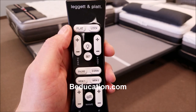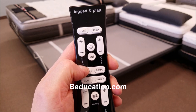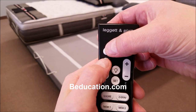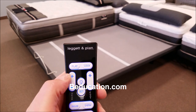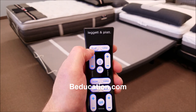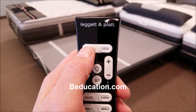One unique thing about the Leggett and Platt remote control with the Simplicity 3.0: it comes programmed so that the flat button and the four pre-programmed positions are what's called press and hold — you have to keep the button pressed the entire time for the base to move. If you'd like to convert those to press and release, so all you have to do is press the button once, hold the flat and the plus button simultaneously for three seconds. You'll hear the power base chirp. Now when you elevate the head section or the foot section and want it to go flat, you just hit the flat button once and everything will go flat. I do like that feature — some people prefer press and hold as a safety measure, which is certainly up to them.